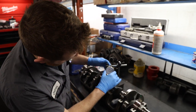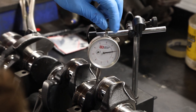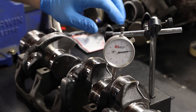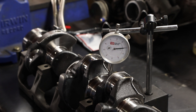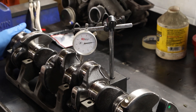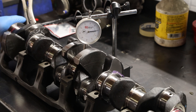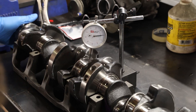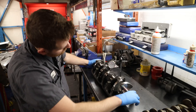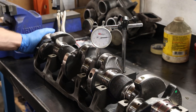We're going to set the gauge to zero. Give it a couple of test taps to make sure it's sitting at zero, and make sure the tip of your needle is tight — it should always line at zero. As we put force on the crankshaft the needle will move, so we need to take an average measurement. Try to spin it as steady as possible. We're getting maybe a tenth total run out — about four ten-thousandths of an inch of run out, which is basically nothing.